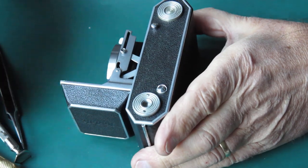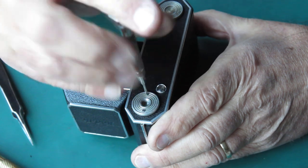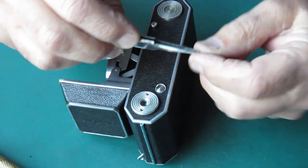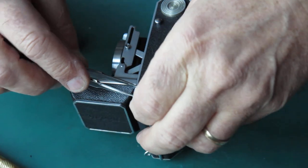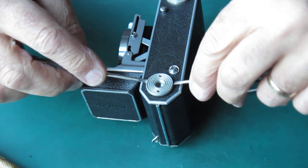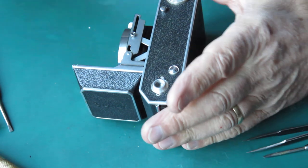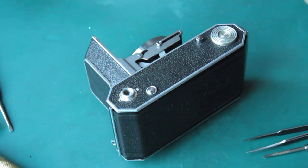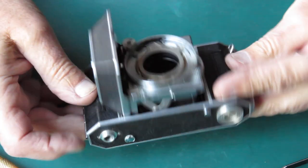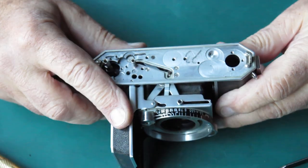Two screws hold the surround here around the tripod socket. You can be careful with those — they're chromed brass, very easily damaged. Let's get this surround off. If they're very hard to move, it usually means someone's forced a badly-formed tripod screw in here that was a bit conical, and it stretches out the top, locking that collar in place. So I'm going to have to peel this leather back now, but before I do that I'll show you a trick — because there may be times when you don't want to remove the leather from the bottom of the camera.